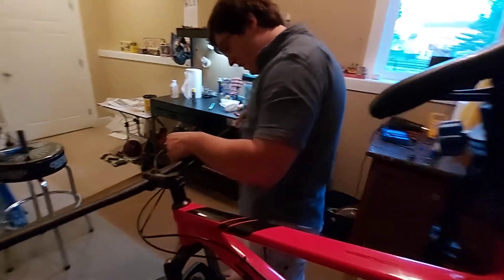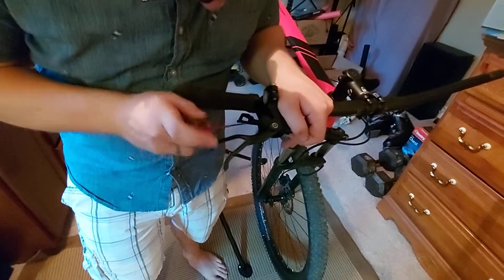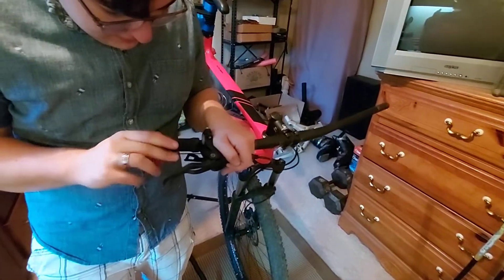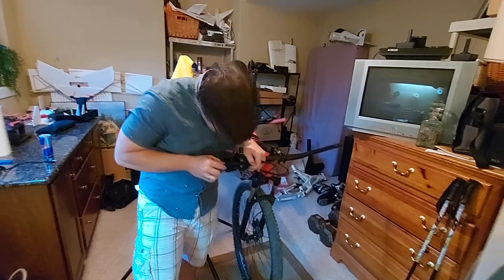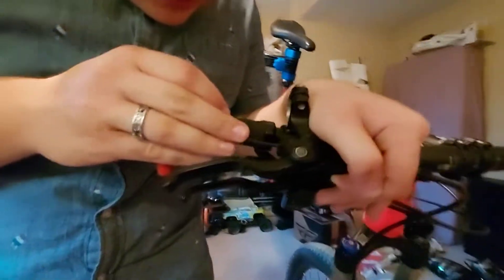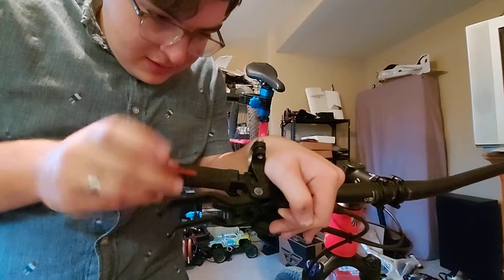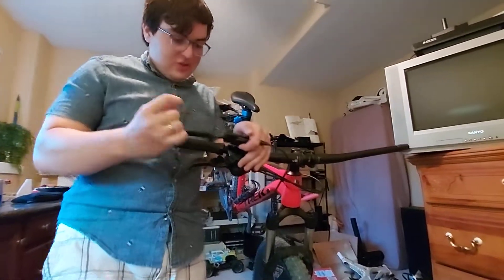When we get more popular, I'd really like to know — do you guys prefer an uncut video where I'm just blabbering on? I'm not sure how interesting I am. Braden doesn't have much to say right now. So all I'm doing here is lining these two brake levers up as best as I can, so I can see how much is poking out on both sides and also check the angle of the brake lever. Pretty close, I'd say — these screws are a pain to adjust once they're actually on the bar.